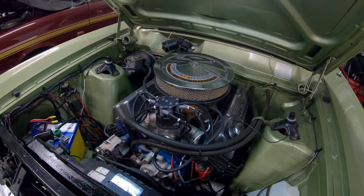With this end-to-end cooling setup, this car just runs between the range that the thermo fan operates at. The highest it'll see is probably 195, maybe 200 at a pinch. But the thermo fan brings it right back down to 185, or between 90 and 85 degrees Celsius. Which for a Cleveland, I've heard, is absolutely perfect.